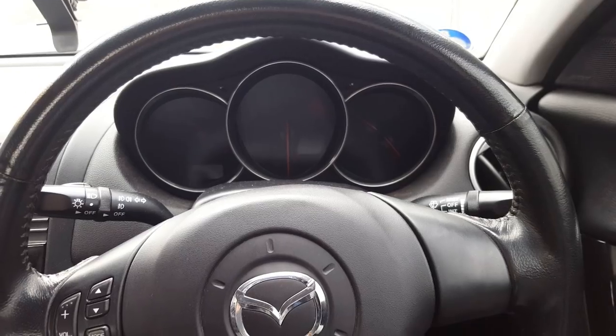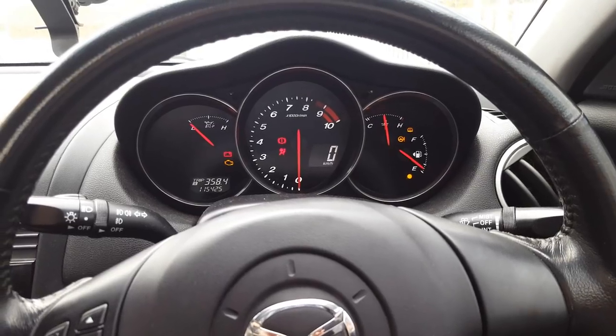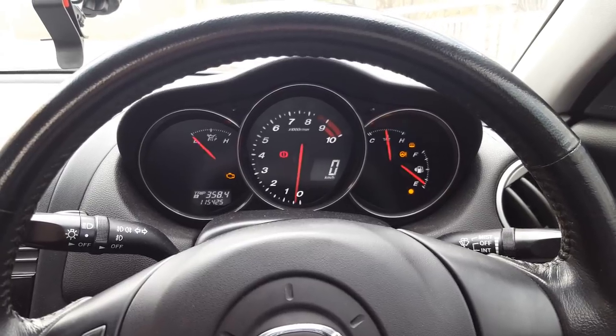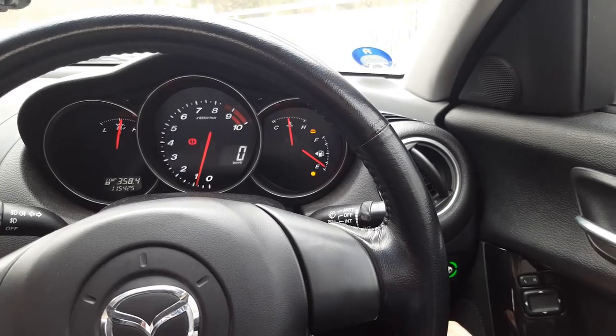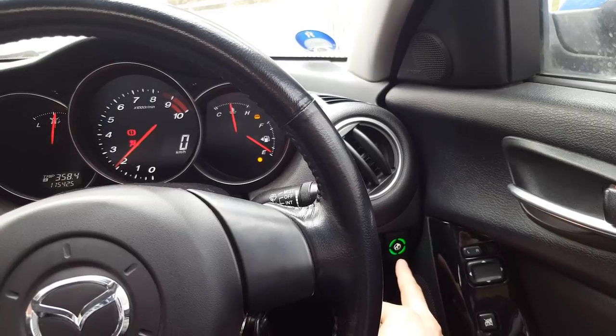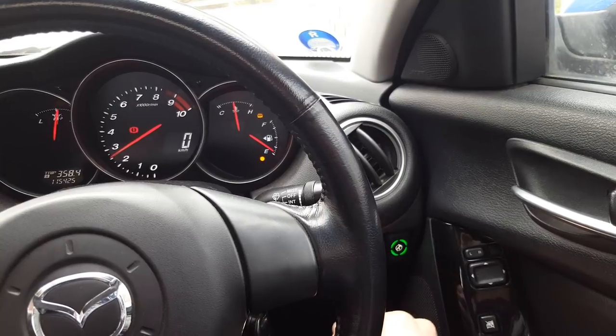I will show you my car, which runs on LPG and is also imported from the UK. So basics on LPG: you put in your key, here's the button. I turn the key and it automatically turns on. Now I will show you how my car starts on LPG. You crank it on petrol — here it's already on standby, and if you're just a little bit over 1,000 RPM you hear the click, and it's running on LPG right now.